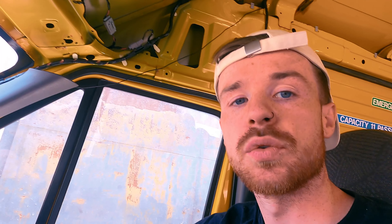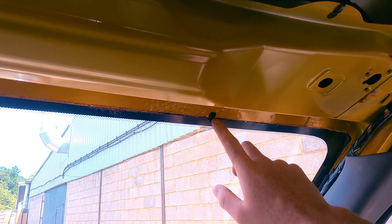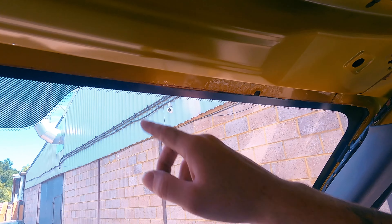The carpet ceiling is off now and we've found where the source of the leak is - it is up there along the windscreen. The glue is missing. There is a cheaper option to fix that rather than replacing the windscreen or taking the windscreen off, and that's using a strong adhesive sealant. So we're going to order some of that and apply it on the exterior, and touch wood that fixes it.